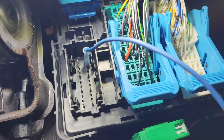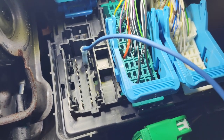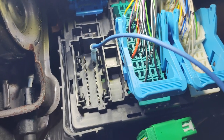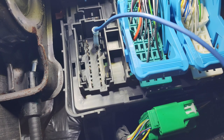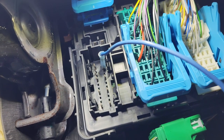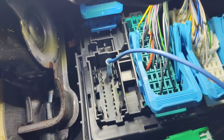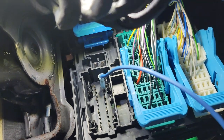In our case, because we were looking to hook up one connection and it was going to require buying a bunch of pins and connecting wires for just one connection, we went ahead and put a connector on the end of our power wire and connected it right onto the actual prong itself, which is really what the switch is doing. Now be cautious when you do this — do this at your own risk. A GM dealer will tell you to buy the proper part, so I advise you to proceed with caution. The top prong is pin number 20 and it is for auxiliary switch number one. I'll post a link to the upfitter website to help out. This wire comes through a special spot in the firewall, and I'll show you where that is in the engine compartment — that comes as part of this option.